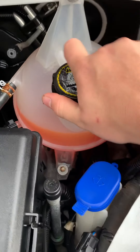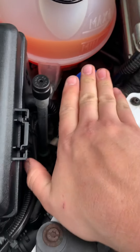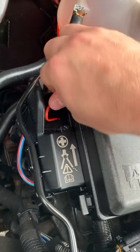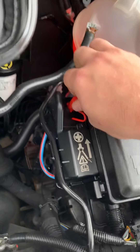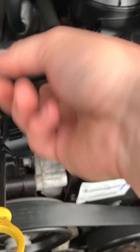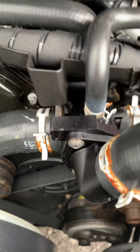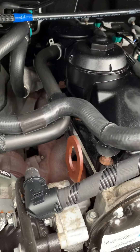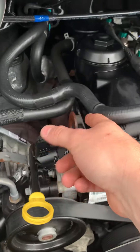You've also got your engine coolant in the reservoir on the right and your washer fluid. If you need to jump start the van, the engine battery doesn't sit under the bonnet — take this little cover off here for your positive jump point, pop it back and turn to the right. For negative, there's a sign saying 'not a negative' so use the engine hoist point down here — that's your best bet for a negative.